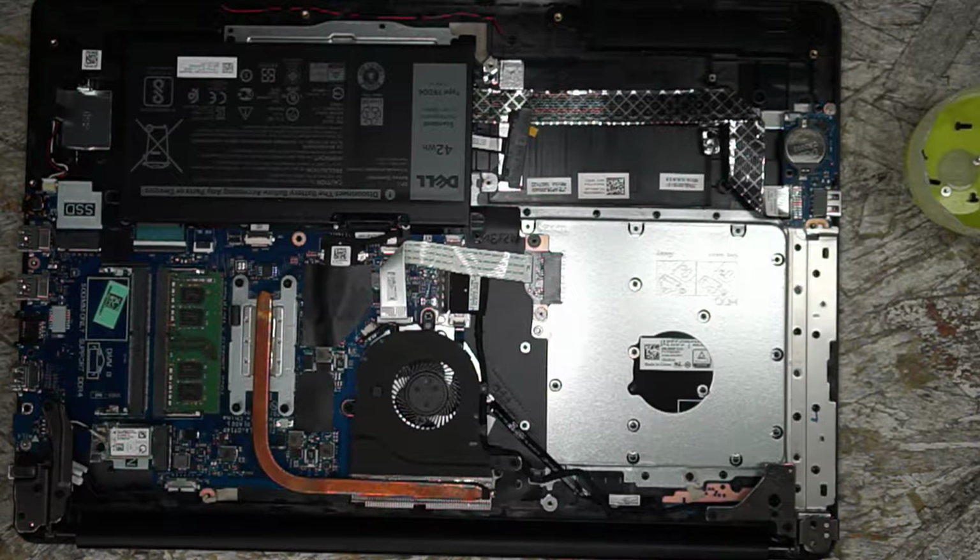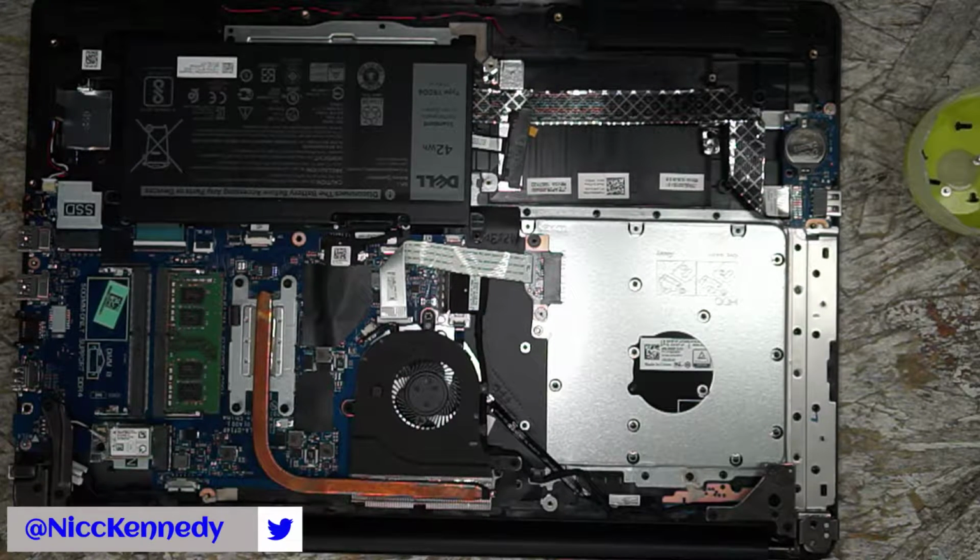Alright, there's a 931.5 gigabyte, 1 terabyte drive. And let's find the other one. And then our SSD. It's found it, and it's going to shrink the partitions to match the size of the SSD. It's not a 1 terabyte SSD. This person does not need the storage, has expressed that, so we're making that happen. That being said, let's hit proceed and let the cloning begin.